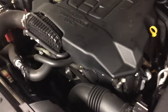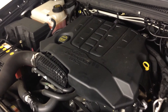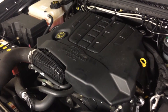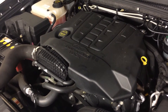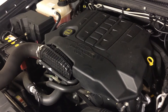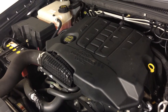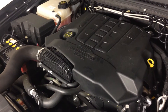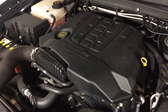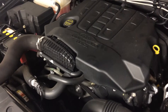The vehicle I'm fitting this to today is an Australian-delivered Ford Territory with a 2.7 litre common rail diesel engine. This is a Ford Duratorq motor. It's been around for many years — it's the same engine in some Jaguar sedans, Land Rover TD V6, Peugeot HDI. It's the DT17, with a couple of engine codes for it. It's 140 kilowatts, 440 newton metres, 2.7 litre V6.